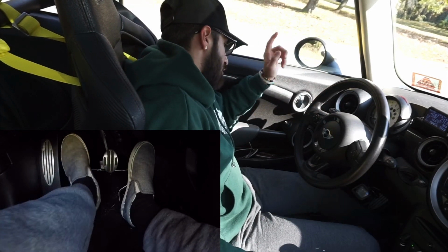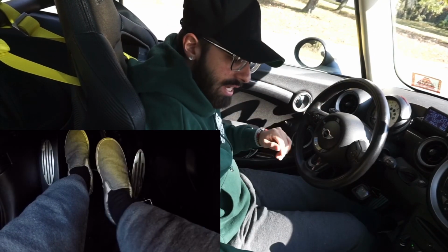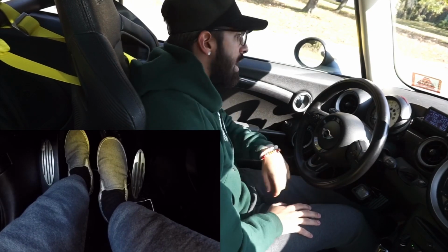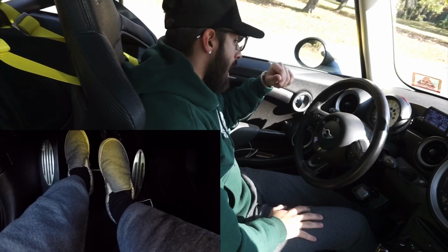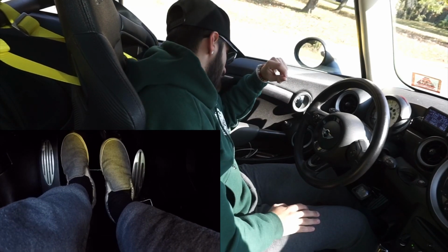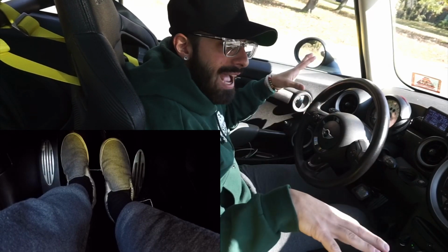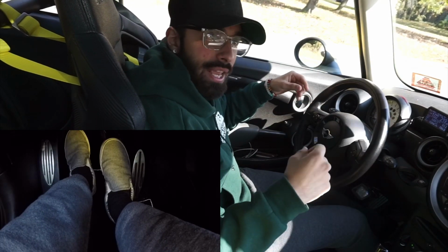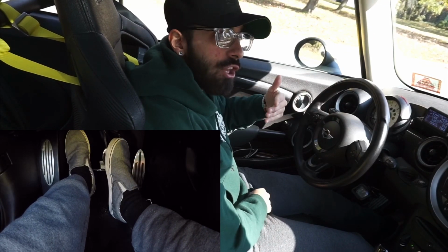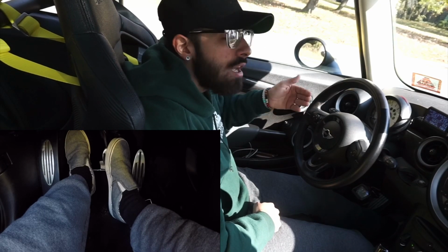So we're going to push the clutch in, and we're going to start as if you're not going to use the E-brake at all. E-brake's down, we're in first gear. My foot's on the clutch, my foot's on the brake. What I like to teach people is to let the clutch out just a little bit, right before the biting point. Nothing is happening. It's dead play in the clutch, so you're not riding the clutch or burning it, because it's not engaging yet.